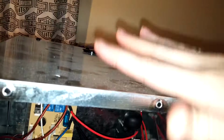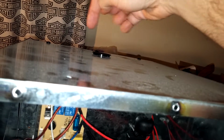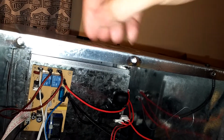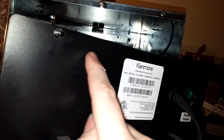See, it actually goes through here. When this is shoved back into the casing, you have just a little gap, and then the switches sit on top of the wood here. The wires will come through here, and I'll put a little hole here and a grommet so they don't get cut because there's sheet metal here. And they'll come out through here, and I'll drill holes on this back cover, 6 holes for the buttons. So the buttons will actually be on the back now,